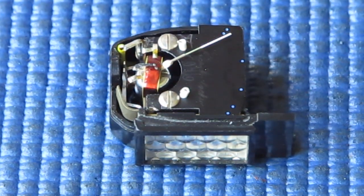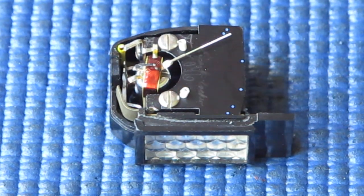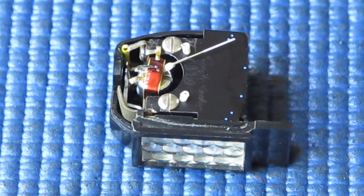I was able to get the hairspring back into shape. But unfortunately it doesn't fix my problem because the meter movement is open circuit. So from a practical point of view, the only thing to be done with this particular camera would be to replace the meter entirely. That being an expensive business because parts are exceptionally thin on the ground, and the probability of any replacement meter not being exactly accurate across the entire light level range — due to the selenium cells being past their use-by date — probably means that might be a fairly futile exercise.